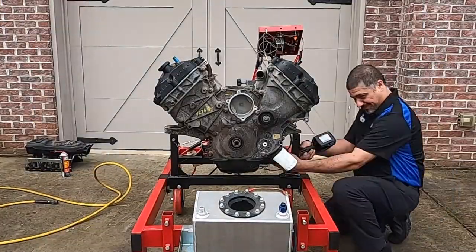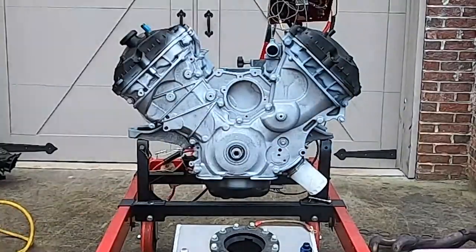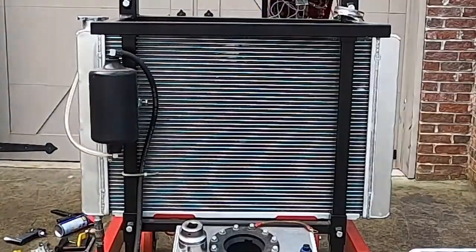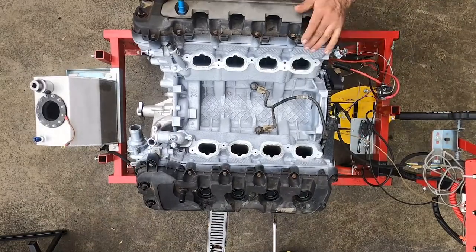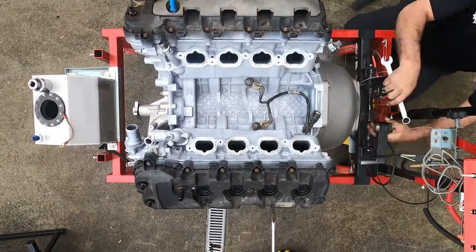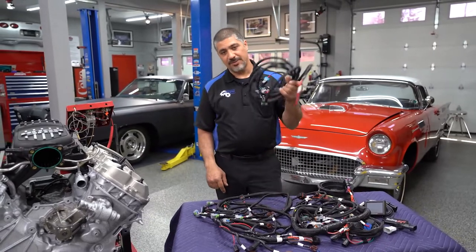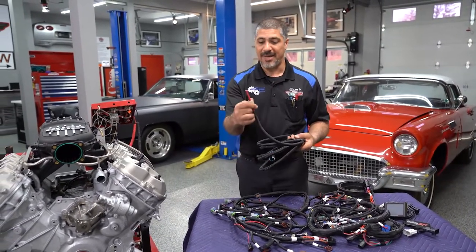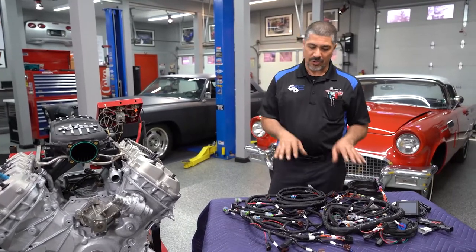You guys remember this engine — Doug and I were doing a leak-down test on it. Look how much better it looks now. We painted it, went to Summit Racing, got the Holley EFI system, aluminum valve covers, and coil packs for a nice install on the 57. When you paint your blocks, stay away from connectors and pins, and when you put it in the engine bay, scrape off ground points so you have good voltage. Looking at the table you might think it's intimidating, but it's really not that bad. We've got four harnesses that combine into one: the fuel injectors, the ignition coils, the main harness, and the power harness. The most important thing is to have a clean ground and power battery connection — you're going to have a signal with the pink and white wire for ignition turn-on.